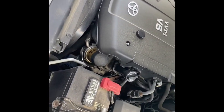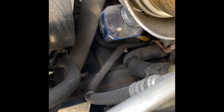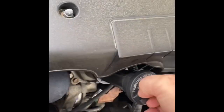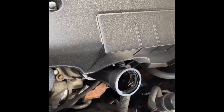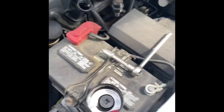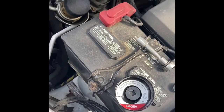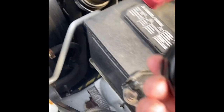Back up top. Just under here I've wedged in a green tea bottle — a little thicker, so it'll do a better job catching drips. With the oil pan draining below, we're going to open up the oil fill cap, which allows oil to be sucked back down. Anytime you're putting tools on top of the engine, be careful — if you don't pick them up and you shut the hood, those tools can drop into the fan belts and damage things.